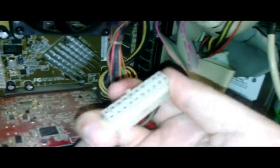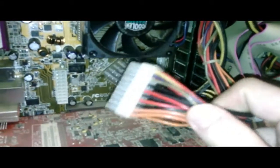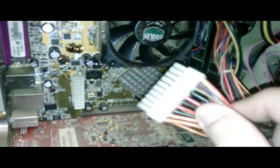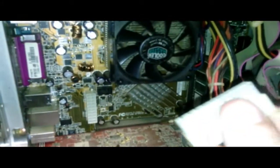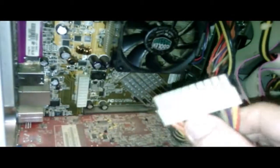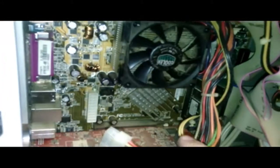You want to make sure your power supply is the same wattage and the same type of connection. In this case, this is an ATX power supply. There was an older power supply back in the day called AT — the power plug for the motherboard was actually split in two, it was skinnier, and had a single row of pins. That was back when Windows 95 first came out. But these days, everything is ATX, so just verify that you have a power supply with the same wattage and the same type of connector.